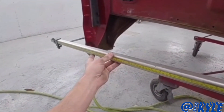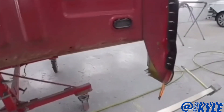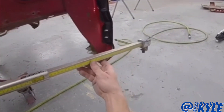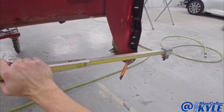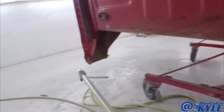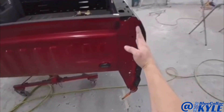I'll show you a little trick I do to make sure the front side of this bed is aligned. I measure out one direction, then flip it and go to the same spot on the other side — you can see it's almost perfect. It's not an exact measurement, but it tells you this is very close to where the cab corner is going to be when the bed is on the truck. I've done these this way many, many times and it works great every time.